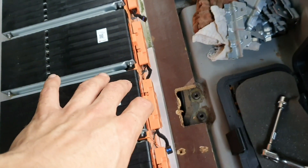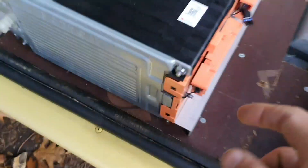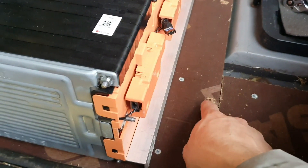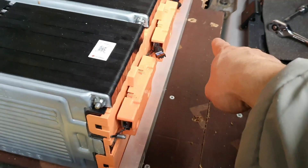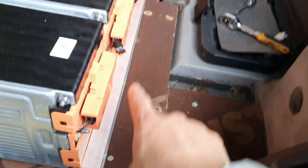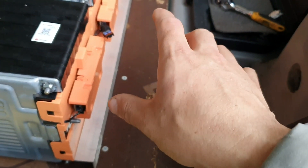So all the terminals are touching and the power will flow down the middle cable, same for up here. Then off each end I'm going to connect it to a square block — one for positive, one for negative. I'll parallel the two strings up so that there's a bit more even power flow.